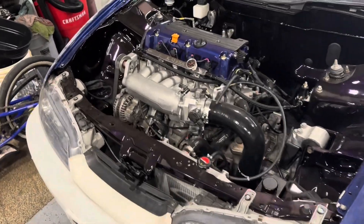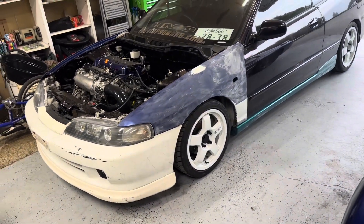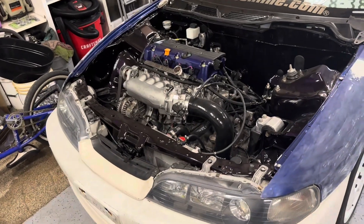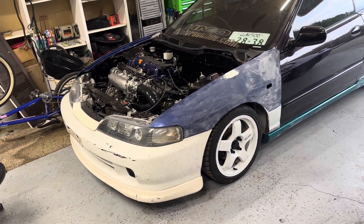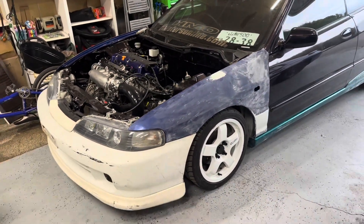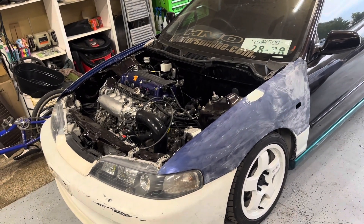One thing I knew as I started digging deeper into the Type R rep was that I didn't want to go with the B18C Integra Type R swap. B-series stuff is getting pretty hard to find — it's an over 30-year-old motor at this point. Finding that and doing the swap is kind of unheard of nowadays. It's way cheaper and easier to go K-swap if you have the time, money, and patience. There are some things that go into K-swaps that are a little more difficult than a standard B-series swap, especially since this car came factory with a B18B1 LS motor.